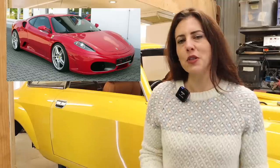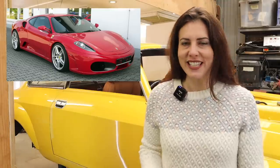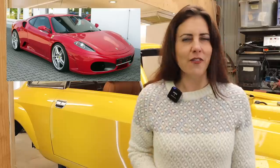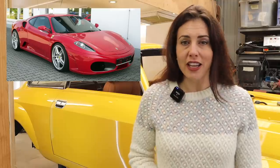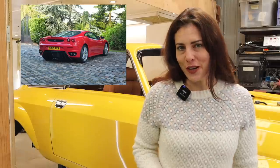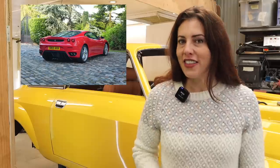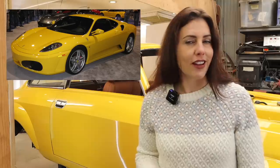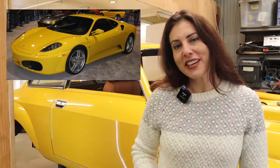Hey guys, in 2004, Ferrari revealed its successor to the 360 with the F430. This car still used the same basic aluminium chassis as the 360, as well as the same roofline, doors, and glass. Interestingly, the facelifted bodywork of the F430 had the same drag coefficient as the 360, but had much greater downforce. The big change in the F430 was the engine. All previous Ferrari V8s had evolved from the Dino race car engines of the 1950s. This new V8 was used as a cross-plane crank by Maserati and in the flat-plane crank form in the F430, making 490 horsepower from its 4.3 litres.